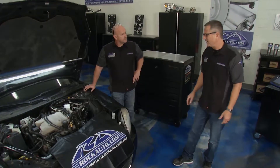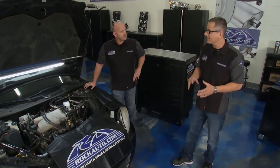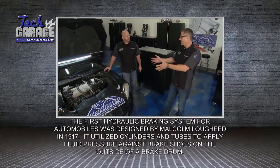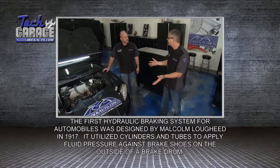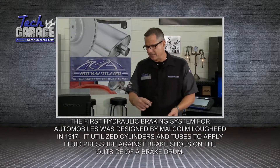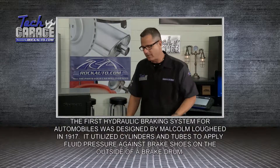The key word there is base brake systems. When we're dealing with the base brake system, think about a window crank and power windows at the same time. The window crank could be the base brakes — which on ours are great, feeling good. It doesn't even feel like it has a brake problem, yet we have this ABS light on. Then all of a sudden we have the power windows — those are out, but the base brakes work just fine.